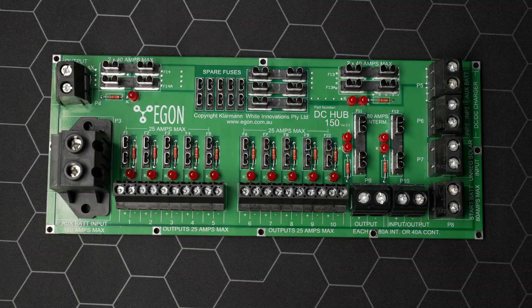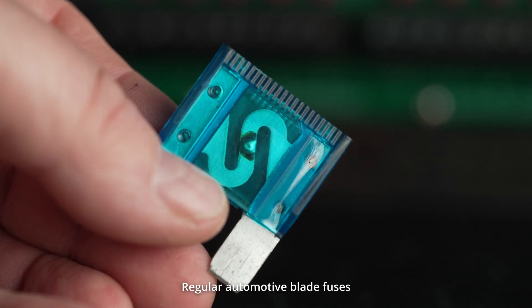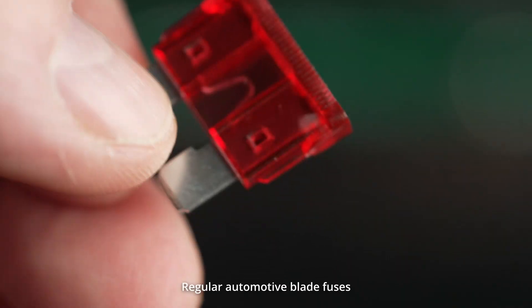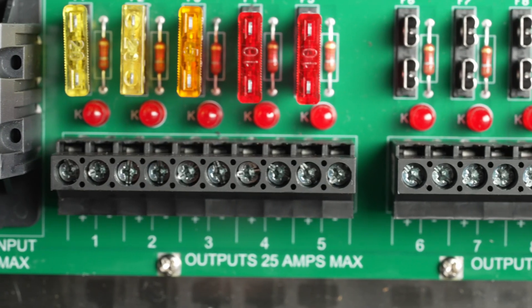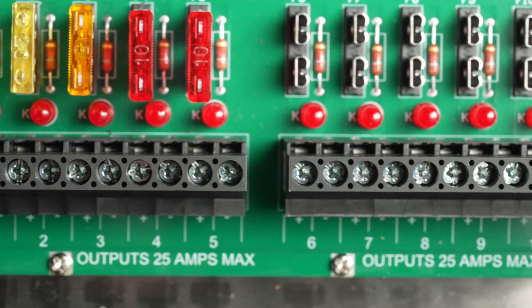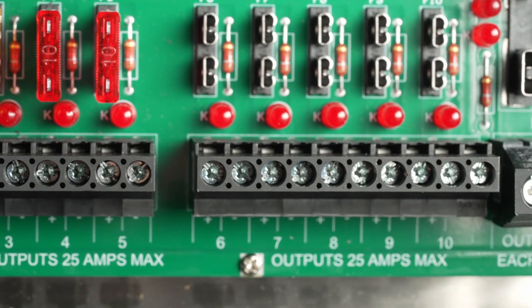Your wiring is complete. All that is needed now is that you put in the fuses — there, there, there, and of course there. These red LEDs: once a circuit is completed, if the fuse blows, these LEDs will glow, indicating a blown fuse.